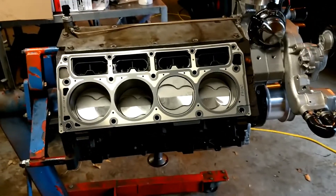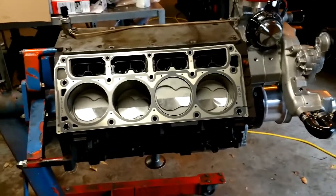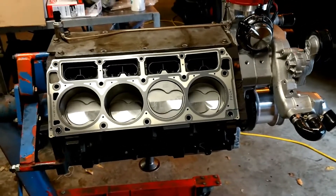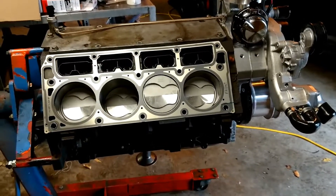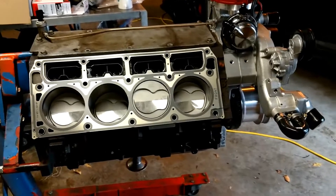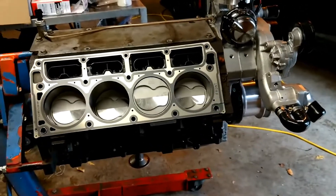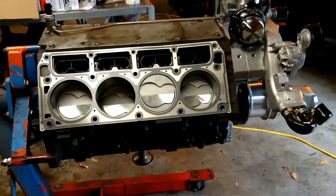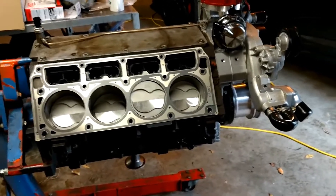It's got the good rods in it. The factory pistons were a recessed piston, and because of the cylinder heads we have to run — they're cast iron — they only did cast iron heads on LS motors in 1999 and 2000. They flow really well for what they are, but they are an open chamber head, so the best you could hope for was 9.5-to-1 compression. I wanted something a little more stout than that. Wiseco makes their new Pro-True Street pistons — a really budget forged piston — and they offer a 4cc dome just specifically for these 6-liters that had 9.5-to-1 compression. They're almost a drop-in replacement. With the 72cc cylinder heads and the stock stroke crank, it's going to be 10.48-to-1 compression. So it's still going to be a pump gas motor — you don't need to run a lot of timing on LS motors. It'll still run 92 octane at about 30 degrees of timing.